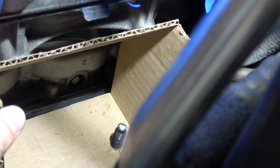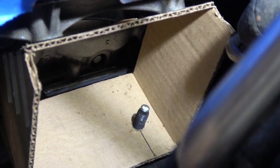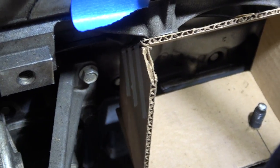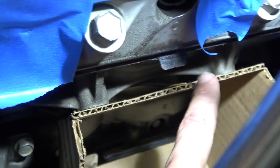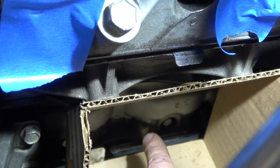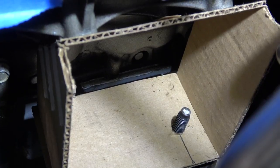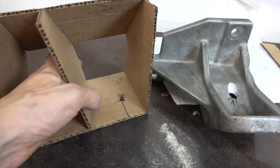Here is the rough mock-up. I've dropped the engine to where it's going to be in place — it's basically sitting down about as far down as it's going to sit. It looks like I've got okay clearance on this side. I thought it was going to be a little tight with the power steering pump mount, but that looks okay. It's a little tight by the power steering line, but I can cut that off. I'm going to add a reinforcing plate here and then try to weld it together. I've got this extra gusset here for strength, and it's already falling apart.